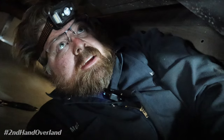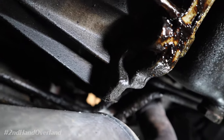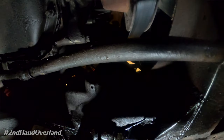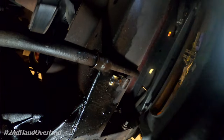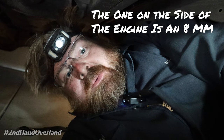I got the back half of the lines out, drained, and disconnected. Now I'm going to start working my way down the length of these lines to the front, disconnecting the brackets attached to them. So far I've only seen two — if I come up with more I'll let you know. It looks like they're a 10mm bolt to get them out, and then we should be able to get to the front, disconnect up front, and start reattaching. After you get all the brackets off, it's time to move to the front.